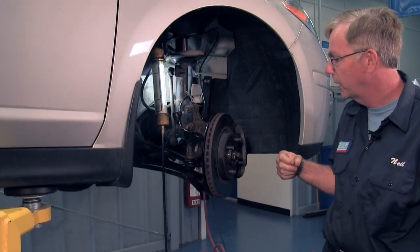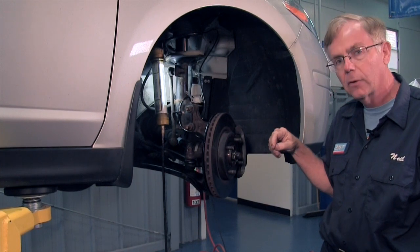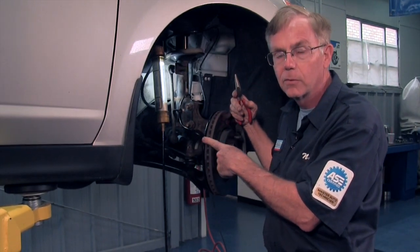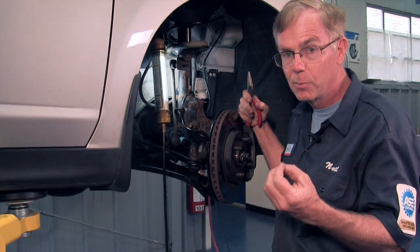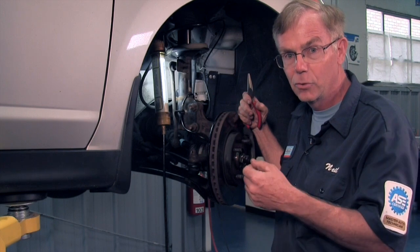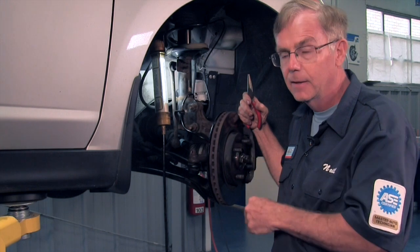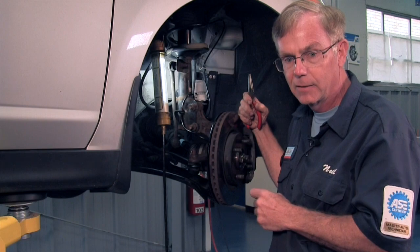I got the wheel off and we're ready to begin. I did hit the CV shaft splines with some rust penetrant — that's going to help us out a little bit later. I also started to remove the 10mm bolt for the wheel speed sensor. That does have to come out first and we're going to show you why later in this video. You also want to spray that down with some lubricant, as they're very difficult to remove sometimes. If it breaks on you, one of the easier ways is to cut the cord, drill through it, and knock it out from the inside. Hopefully you can loosen it up with rust penetrant and it will be removed easily.